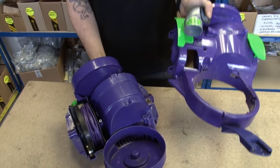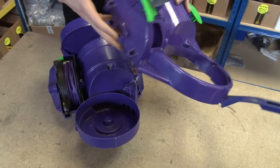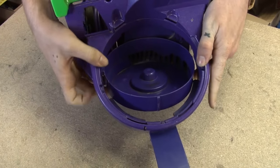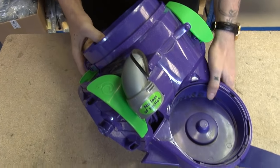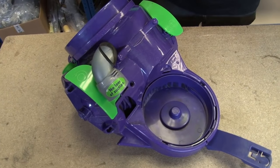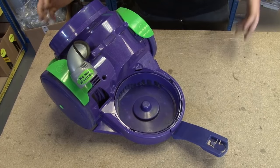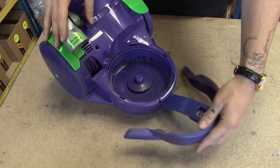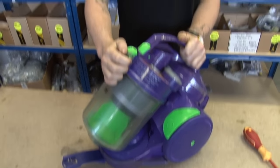The next bit is putting the upper motor cover on, and you can see now why we removed the wheels — they would have obviously got in the way. Basically, there's a trick to this: you need to slot this round part onto the other round part, and it just sits in like that. So now we've got the three main parts of the body back together. We just need to re-screw the holding screws. Now the main body is all back together, I'm just going to put back on the external parts. One motor changed on a Dyson DC05. All these spare parts are available at the eSpares website, as well as the Torx head screwdriver set I used for the job. Thanks for watching.